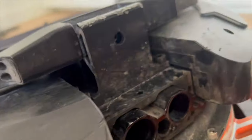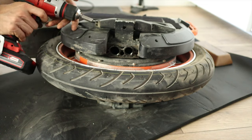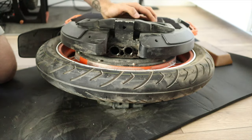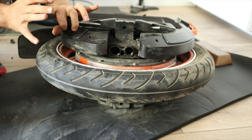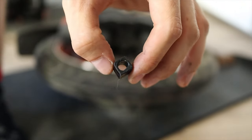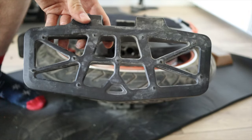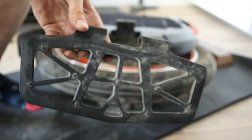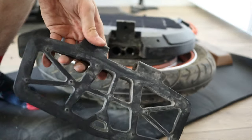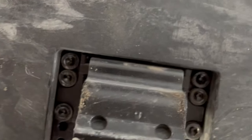Now we'll remove the pedals. There was a grub screw on the bottom which I've lost, and there are two small hex screws with a plastic spacer on each side which hold the rod in place. There's some friction to overcome in order to remove the rod, and there are rubber pieces inside which keep the pedals upwards when folded. The pedals are big and spacious but slippery when wet — the studs are milled in and there's not a lot of them. They should be screw-in like MTB pedals, and they're also not angle adjustable.